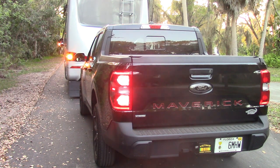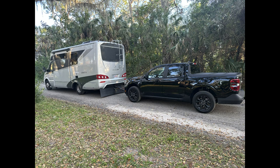I have tried to come up with a way to handle the need to exercise my Maverick every 6 hours without unhooking the RVI brake. I have failed. I plan on starting the Maverick and running through the drive in reverse every night when I pull in, even if I have done so sometime that afternoon. That is probably a good thing because I have been known to forget to unplug the brake in the evening when pulling the Jeeps. If I have to disconnect the brake, then I will definitely be unplugged. There will be no reason for unhooking the tow bar unless I have to go someplace.